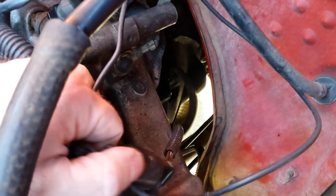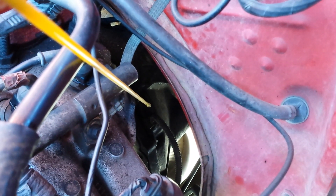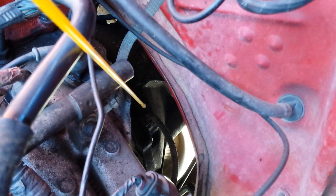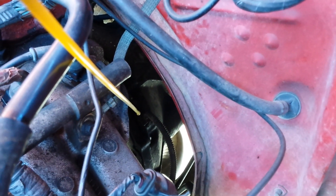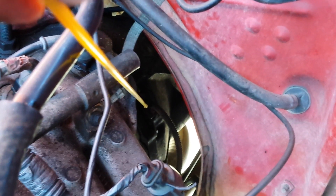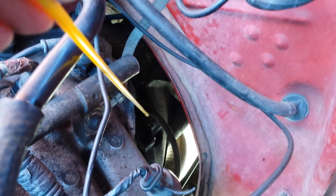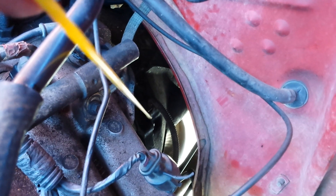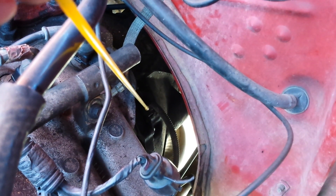Using a pointer, you can see the wiring harness and the crankshaft position sensor. It's held on with two bolts — 11 millimeter socket size. On a Cherokee, it's a massive pain to get to; you need a lot of extensions and have to come in from the bottom of the Jeep. Wranglers have a bit more room, and a three-inch body lift helps even more. The sensor bolts into the back of the bell housing.